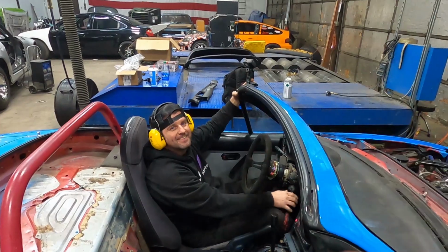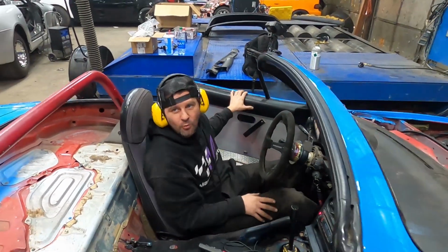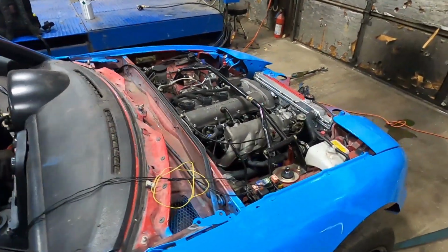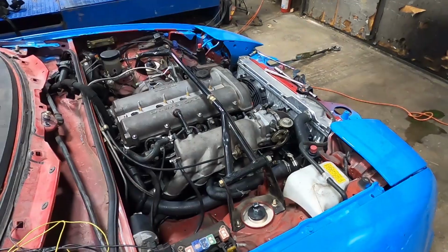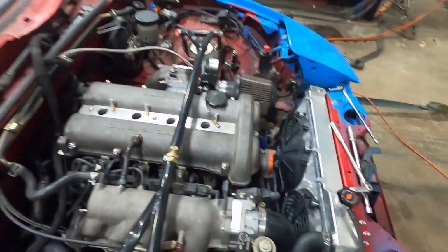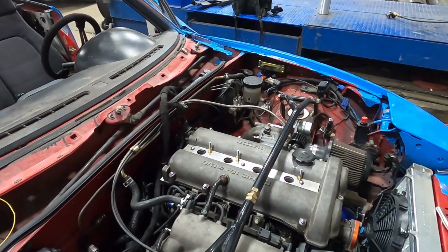And I was even like, gap. Yeah, that's why I just stopped. I was like, misfire, misfire, misfire. All right, pull some plugs. All right, so we got the plugs coming out now, and we're just gonna gap those down, and then put it back together and make another rip.